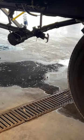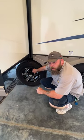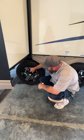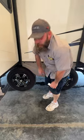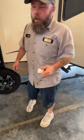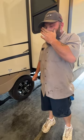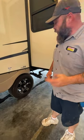While we're also right here, we do want to make sure you torque your lug nuts to 110 foot-pounds. That is to be done at 50, 100, and 200 miles. You always do want to keep the tires topped off to their max PSI level, which these guys are 80 PSI. I always like to recommend whenever you leave the campground, the first place you stop is the gas station — as you're refueling, you can check these lug nuts, knocking out two birds with one stone.